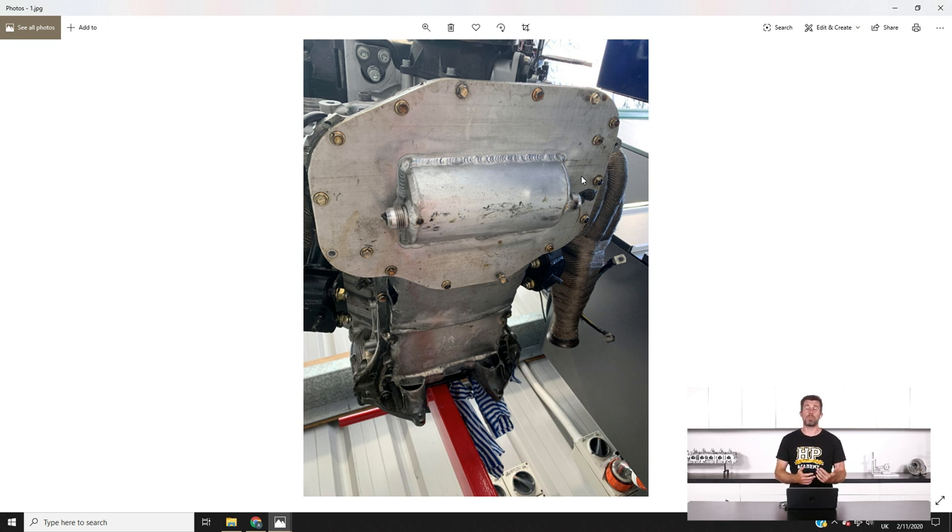At the same time we wanted to do a better job of pulling a vacuum in the crankcase. There are a couple of reasons behind fitting a dry sump system - the key one of course is that on a racetrack, the G-forces being pulled under acceleration, braking and cornering mean a stock wet sump will generally not work well. You're going to end up with the oil running away from the pick-up, drawing air in, and it doesn't take very long with oil starvation like this for your engine bearings to suffer dramatic failures.